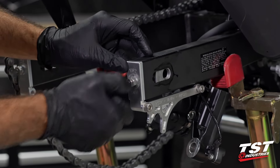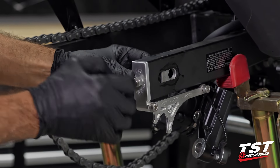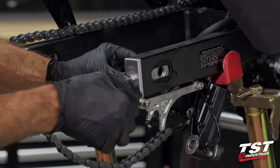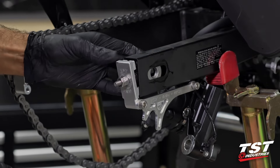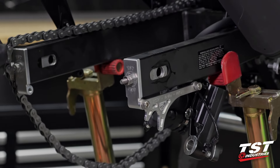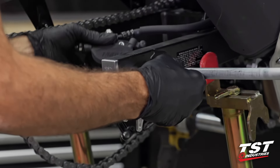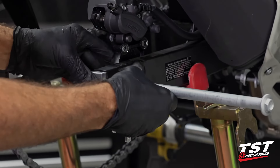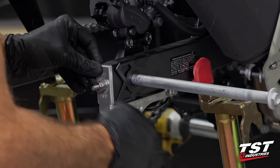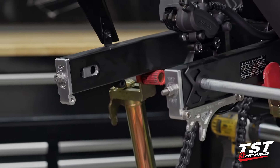As you can see already, this axle receiver within the swing arm stays where you leave it — where you adjust it to. So let's say you adjust it to here and lock it down; it'll stay here. Even if you bump it, once this is locked down it'll spring back to where it was. I'm going to get my axle partially through, get my brake carrier remounted, get all these components jiving together. Still loose — that's why you see it a little sloppy, no big deal. We'll tighten it up. Let's attach our GP lifter to the left side of the bike.